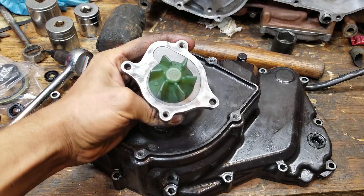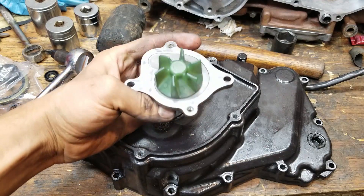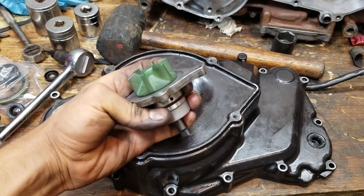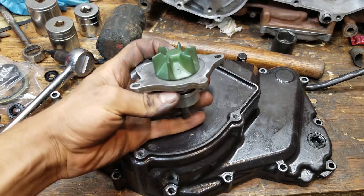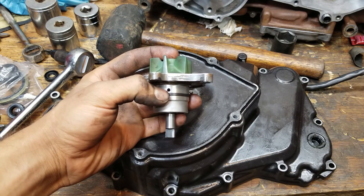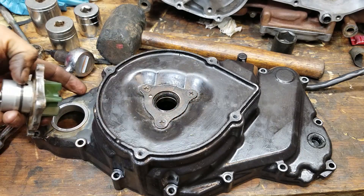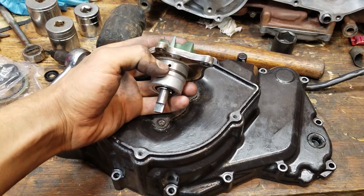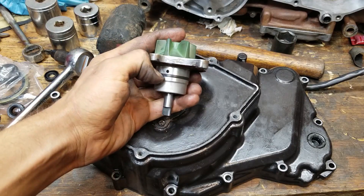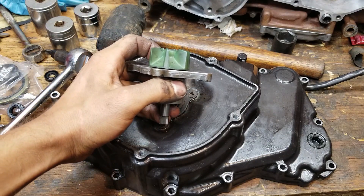So I was wrong — this assembly just pops out like that. I need to get to this O-ring right here, but yeah, it's easy enough to fix. If it starts leaking I'll just bust the guts out of it and replace it, so that seal seems fine. I cleaned up this shaft, and the reason I don't want to mess with the mechanical seal is because on a Grizzly 700 I had to do it like three times — that mechanical seal will weep right out of this hole, and it'll pee coolant all over the ground. Not fun. So let me replace this O-ring and bolt this whole assembly back up and stick it back in there, then we'll be on to the next oil seal.